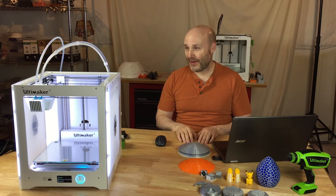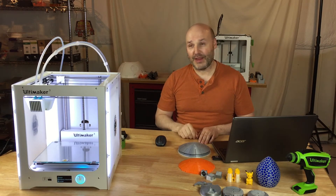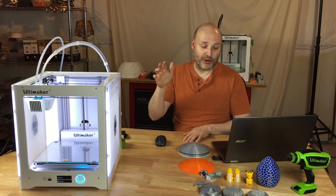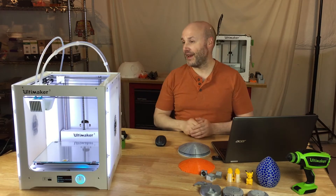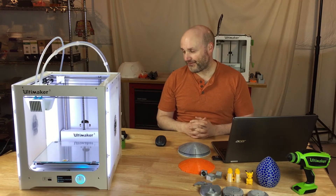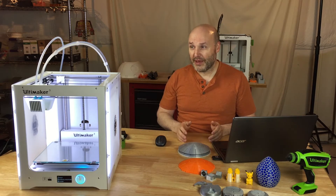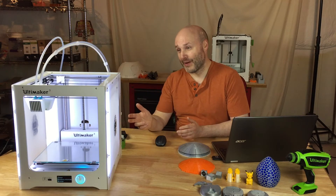The extended version is a little bit taller — this one is 7.87 inches tall, and the extended is 11.81 inches. The Ultimaker 2 extended version is 12 inches. I think what's happening is we're dealing with a much bigger print head and some other mechanics that have limited the space a little bit. That's one of my small gripes with this printer — the loss of print volume — because I have a lot of my BB-8 project prints that I was really looking forward to doing with the PVA support. But they barely fit in the Ultimaker 2, and they certainly wouldn't fit in the Ultimaker 3.